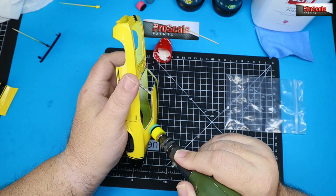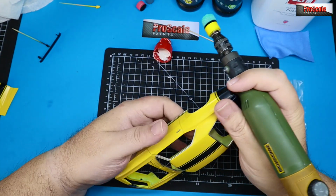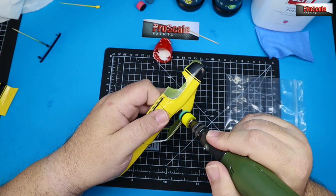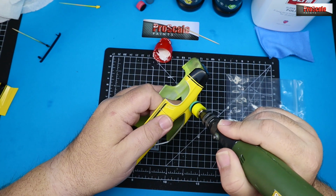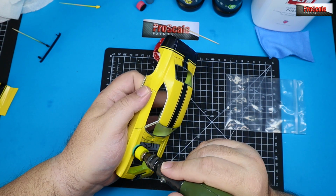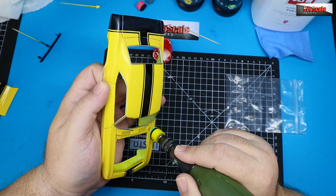The 3M pads do a great job of flattening back that 2K as well. And I say this every time now. I resisted using these polishing sponges for so long out of sheer stubbornness. And what a game changer they are. If you've never used them before, I'd highly recommend trying them. It just saves time. What would take 3 hours takes less than an hour now. The result is much better. It beats hand polishing by a long way.